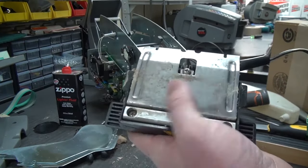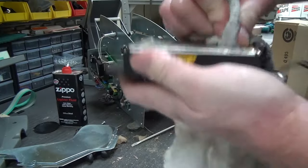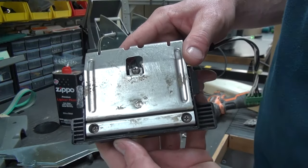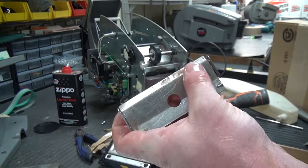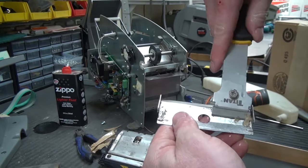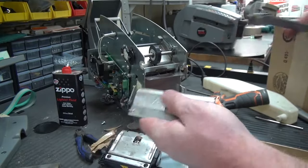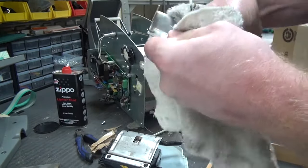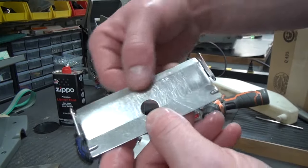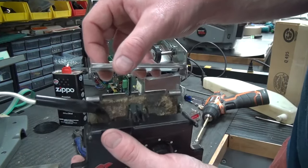It should feel smooth — if it doesn't, grab a washcloth and clean it like so. That looks pretty good compared to what we had. I've soaked our lower heater plate in some water; that sometimes helps the glue break up and you're able to just scrape it right off. What you're doing here is cleaning up all those jams you had to deal with. Take a rag and wipe it down. That right there is a clean plate — you shouldn't have issues with jams from this plate. This plate snaps onto the underside of the heater.